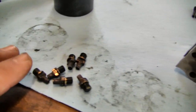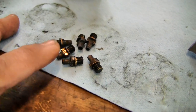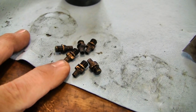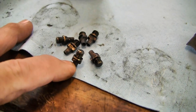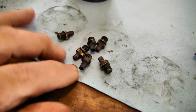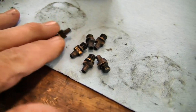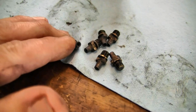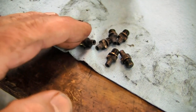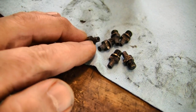Our other problem — if we look at the nipples, we see there's a huge buildup. There's residue on these nipples, and the caps do fit on very tightly. As this stuff builds up on there, which doesn't come off easy and won't just rub off, I think it makes the fit tighter. And if it builds up on the very ends, the reason I get misfires is the caps are not going down all the way — residue is keeping it from seating properly.